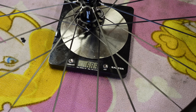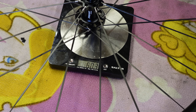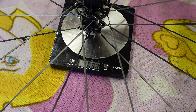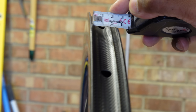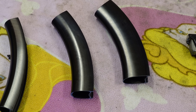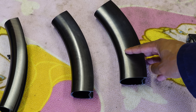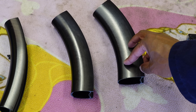Weight of the front wheel is 603g and the weight of the back wheel is 692g. External width is 30mm and internal width is around 23mm. These are the 55mm depth rims, though they do come in a few different sizes. The rim design is clearly intended for modern wider tyres, driven quite a lot by gravel and tubeless — so 30mm wide on the outside and 23mm on the inside.